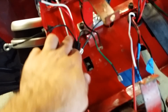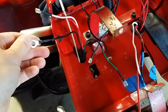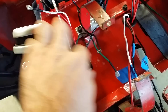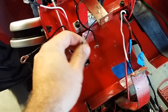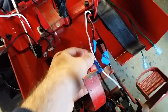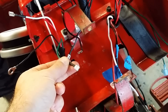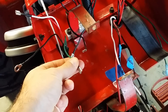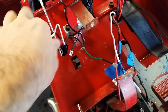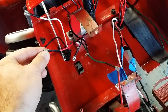You can see this is where the wiring is right here, and the tach is pretty simple. You have black as your ground, so this is gonna go to the grounding block. The green wire is the signal wire that'll be connected to the magneto kill switch. This will get pigtailed into that so it receives a low voltage signal.